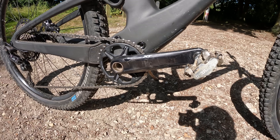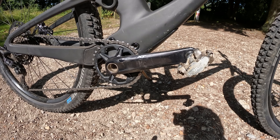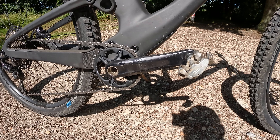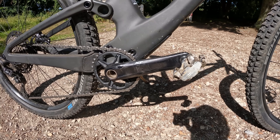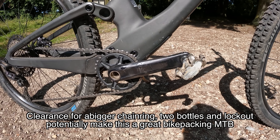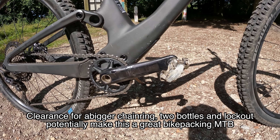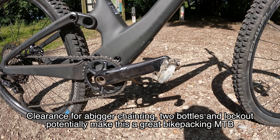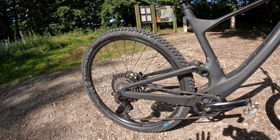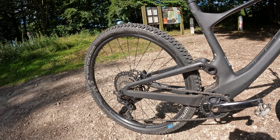It's all hidden neatly inside there, but it's 120mm, and then you've got this flex stay rear end, so there's no rear pivots. The whole thing is really, really super neat, and you can even see the way they've smoothed the lines in there. There's a little skirt over the back — just really, really neatly done. You've got a carbon fibre protector there where most brands would use a metal one, a really nice ribbed chain dampening strip, and then there's the hatch you open to access the top of the shock if you need to change the air pressure or the rebound settings.